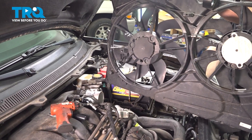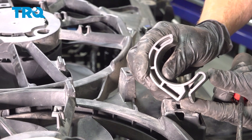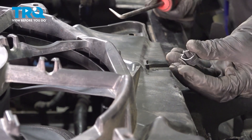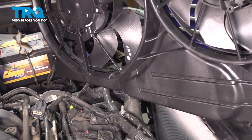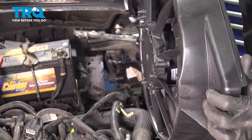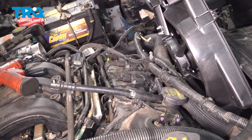There it is. On the fan assembly, you're going to want to remove a couple pieces: the upper radiator hose hook, and on the other end, the area for the hood release cable. Transfer all this over to the brand new assembly. Now we can get ready to install our brand new fan assembly. Before we put the upper radiator hose hook on, let's make our way to putting this down into position. As we slide it down, it's a good idea to have the hose and the wiring pressed towards the rear of the vehicle.